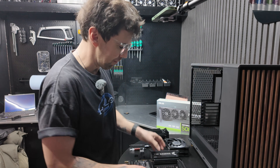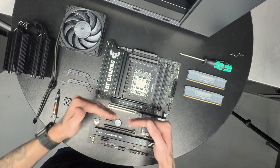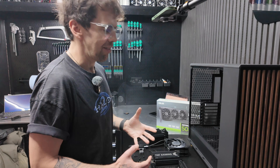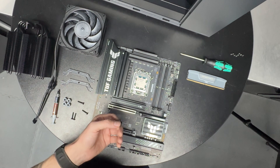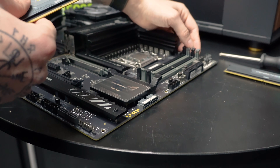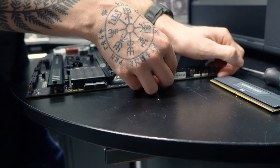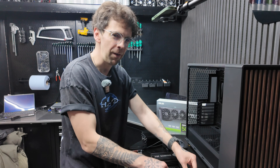Next up, it's time for the RAM sticks. The most common mistake is that the RAM sticks are put closer to the CPU, as if people think that's going to get them the most speeds — whereas actually that's not the case. You could actually halve the speed of your RAM that way, not getting those high transfer speeds. So the common rule of thumb with installing RAM is that you put it in slots two and four if you have two sticks. Open up the clips, look for the little slits, line it up with the line on the slot, give it a bit of a push down, and you'll hear a pretty satisfying click. Then once again with the second stick.